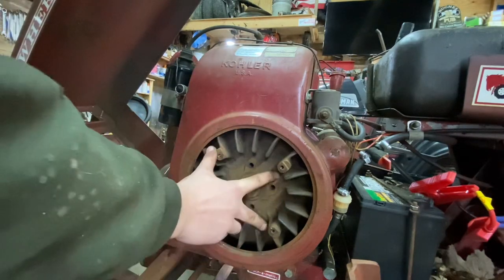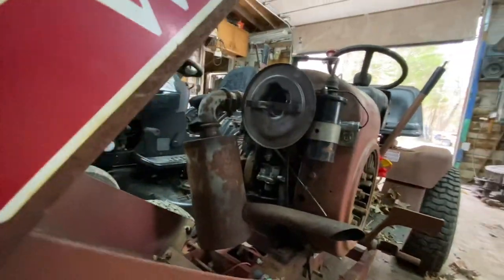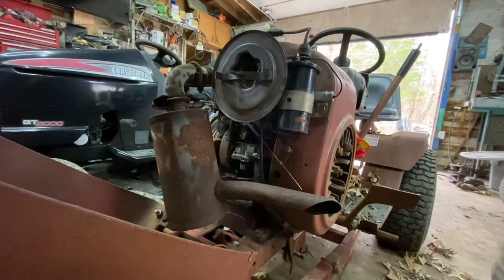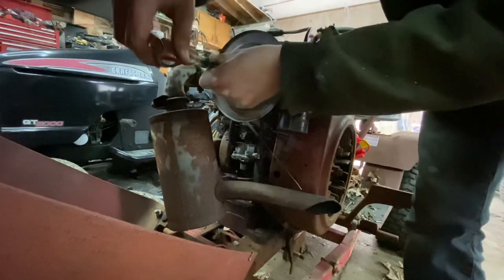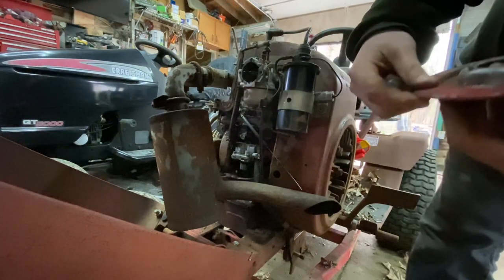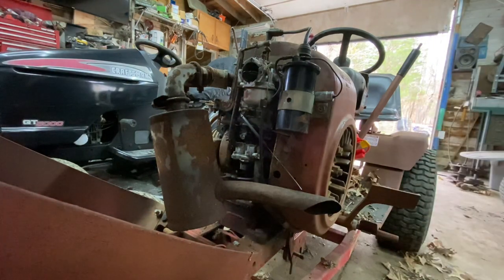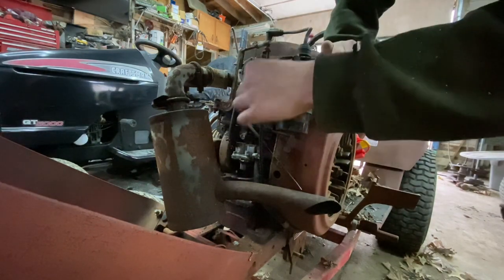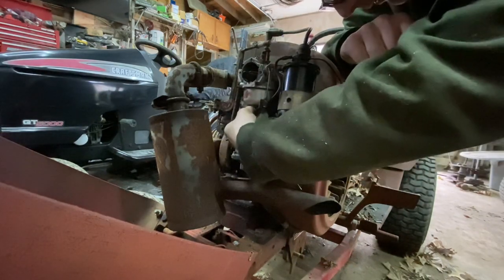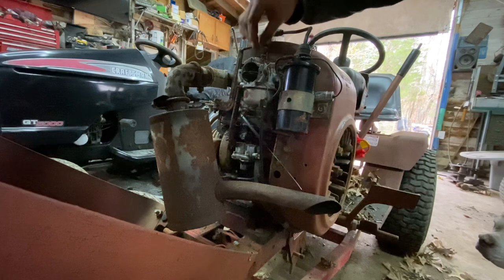I got this cover back on. I won't put the flywheel shield back on just in case I have to take it back off - don't want to deal with those Phillips head screws. Moving over to the carburetor - it's in the front of the motor so it should be fairly simple to remove. First, two flat heads hold this air box on. There's some kind of crappy little gasket here - I'll probably put just a thin bead of silicone on it once I know it runs good. It's got a couple linkages, and this bullet nut's loose - good thing I didn't keep trying to run this thing.